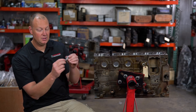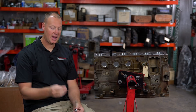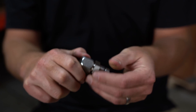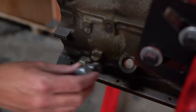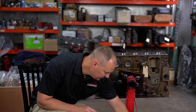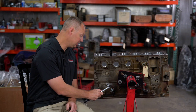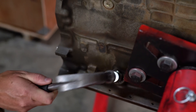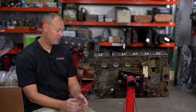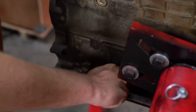The reason is we put a little taper right here. We send it with this cool cap, and the reason we send this cap is so you can literally beat it into your block. You put this on here, fish it into your block — it takes a minute because it's a very, very tight fit. Tony used a mini sledge. You just tap it in there. So now with the tapered fit, it's seated all the way down. To get this out, I'm gonna have to get a little tool — it's not gonna come out by hand.